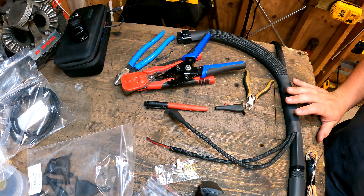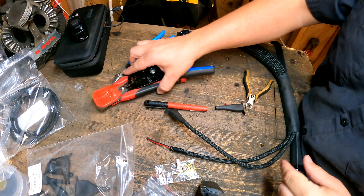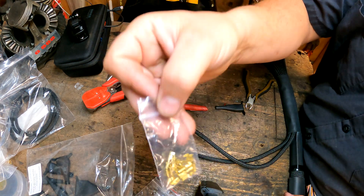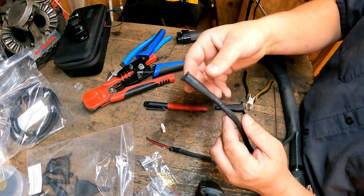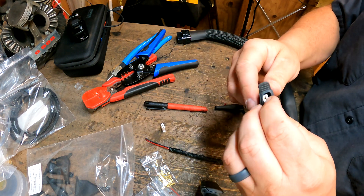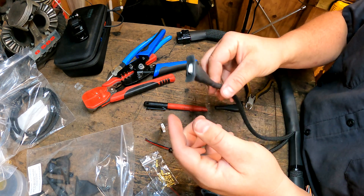Let's jump in to putting the connectors on. If you've watched my D-Jet harness video, this is going to be very familiar, but I'm really trying to do it even nicer than I did last time. I've already done one — I put a piece of heat shrink on, slid the boot on, slid that all the way up, made my connection, slid it down, and heat shrunk it. So basically, this boot is going to cover the connection completely on the injector. I'm not going to say that's necessary, but I think it does work pretty well.